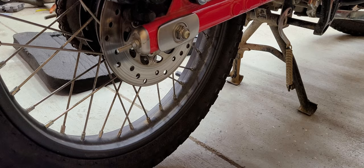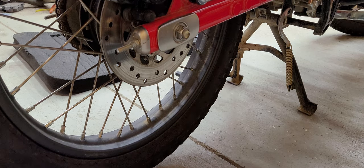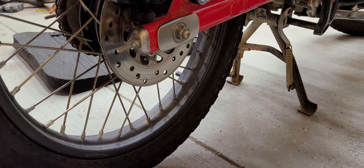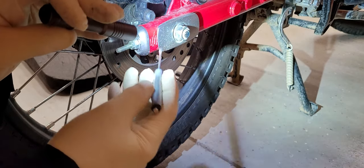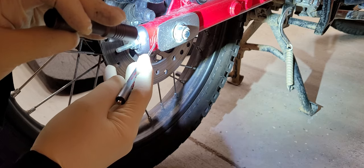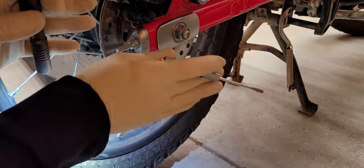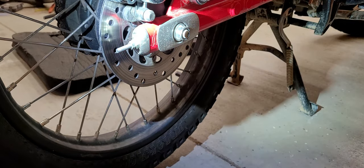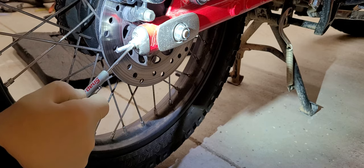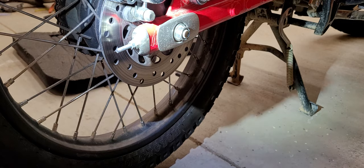A good thing to do is pay attention to where it is. You've got these little slots here. If you count from the back — one, two, three, four — we're pretty much in line with that fourth slot. It's really critical if you want the bike to track correctly and get both sides the same, or the wheel will be off. Let's break these loose on both sides — this is a 10 and a 12. We'll hold with the 12 and back this off some. Back them off to here and that'll let the wheel go forward.